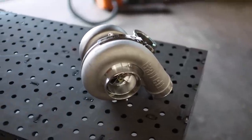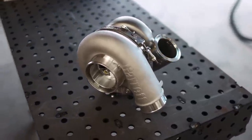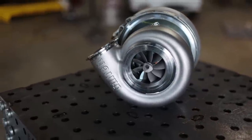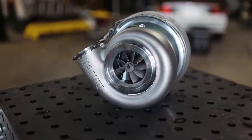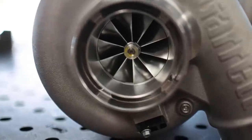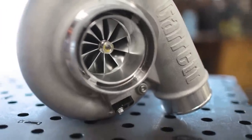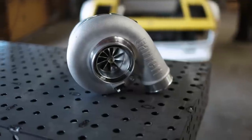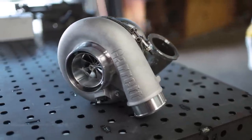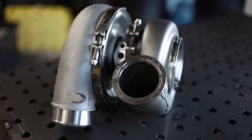What will add the most weight is the turbo system. We finally have the turbine housing for our G42-1200 Garrett, and the complete setup is coming in at about 32 pounds — plus the rest of the entirety of the turbo system. The weight isn't surprising because this thing is huge — it's about the size of my head. The 1,200 horsepower ceiling isn't going to mind lugging it around once we hit that point. With a turbo manifold, water-to-air exchanger, all the charge piping, wastegate, and blow-off valve, it's a decent chunk of weight — but I'm still confident about where we'll end up.